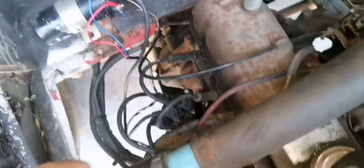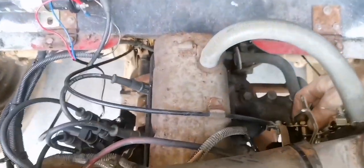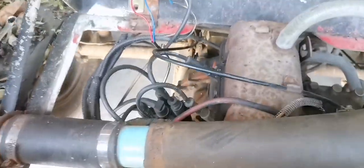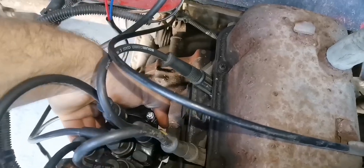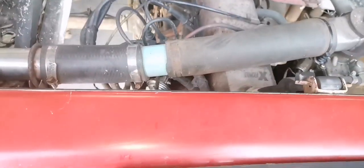You have your adjustment here. All the wires still fine — good. Let's start it up. You can hear that the timing's not correct. I'll adjust it now by turning it slower or faster. We need to get our timing light and check if we can put this thing on the timing.